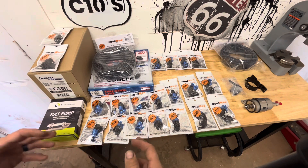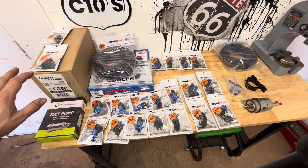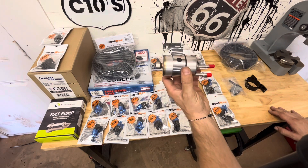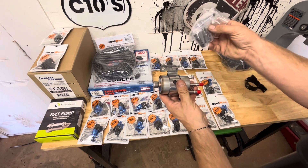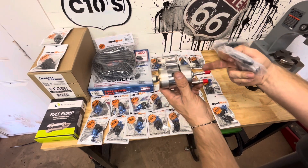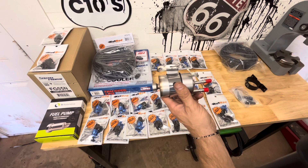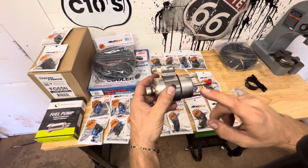We've got straights, 45s, and 90s. We'll have dash-6 coming out of the fuel tank itself, with about two 12-foot sections running into this WIX Corvette fuel filter regulator — I'll link the part number down in the description along with the adapter fittings to make it dash-6. Basically you'll have two compression-style fittings go on here, so we'll have just two one-foot sections of the black with blue checks PTFE hose going into this, and then just one hose coming out.